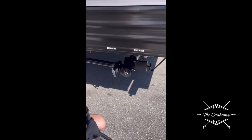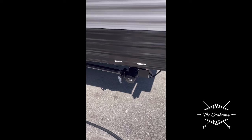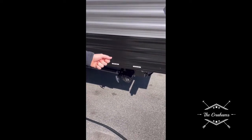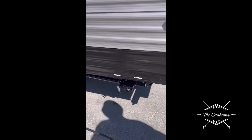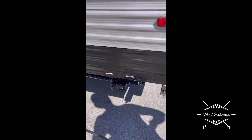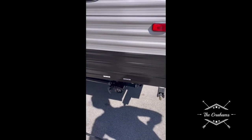The tank is closed; open is out. When you are flushing your black tank, you want to make sure it's in an open position so that when you're flushing it, it's not backing up — it's got somewhere to go. When somebody's actually using the toilet, you want to make sure it's closed. You only open it when you're flushing or dumping.